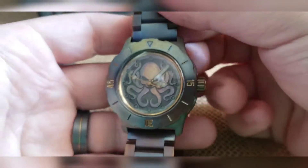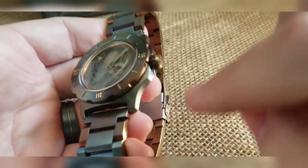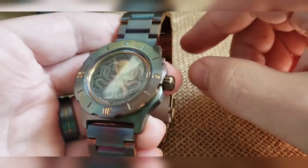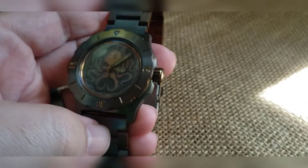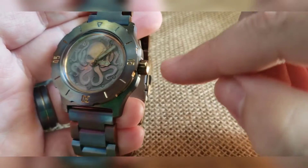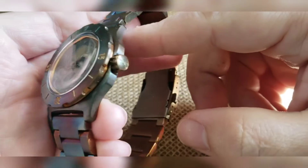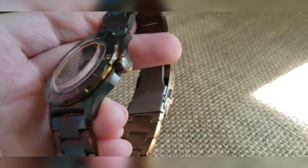I used a yellow gas torch — the brush case torch, the bezel — torching the crown is very tough to do because if you torch it too long, these are factory pressed with the stem into them and it'll separate. So I just had to hit it and get away, hit it and get away, keep letting it cool down, and in the end we got a nice bronzed look to it.